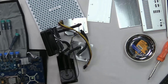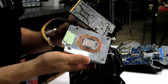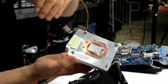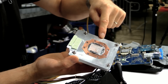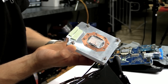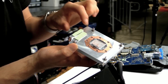Let's have a look at the water cooling stuff first. Wow — that is a lot of thermal compound. What the heck, Zotac. The good news is it didn't leave a whole lot of goop on the actual CPU so I can deal with that. They've opted to make a completely custom block, but I do have to wonder about the wisdom of using aluminum and copper within the same block design. If Swiftech couldn't pull that off without corrosion — and their Apogee GTX was a total disaster — I don't know how much faith I have in Zotac's ability to do it given Swiftech's vastly superior water cooling experience.